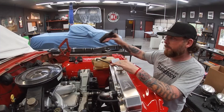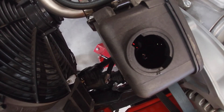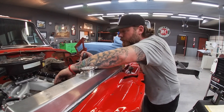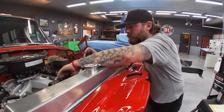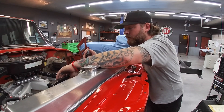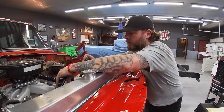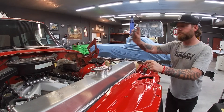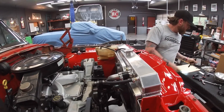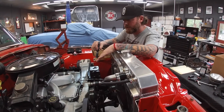This Jeep's got a brand-new gearbox, brand-new pump, reservoir, lines, and everything, so it'll take a bunch — almost three pints. This system doesn't have a cooler, like the Motorsport Drive performance stuff where we put big coolers on and they'll take four or five pints. I really won't put any more than about two pints now until it runs, because when it runs it'll find its own level and you top it off from there.